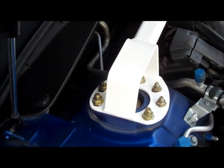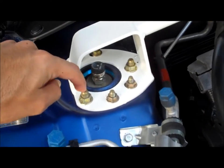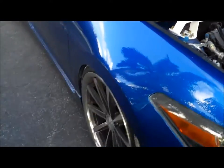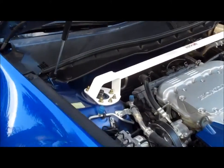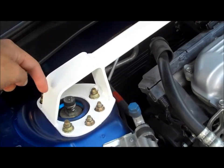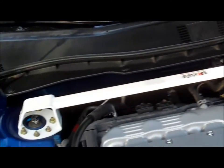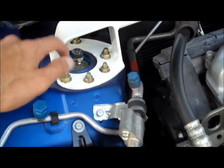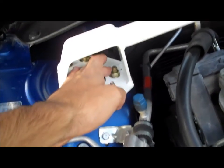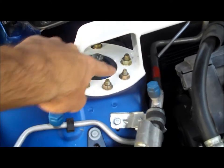On the UR, you actually have to remove all the bolts — these are 14s, the small ones are 12. While the car is not jacked up, that way the suspension is compressed, you're just going to unbolt all the bolts on both sides. Once you have that done, you slide the new tower on and bolt it all down. You do need a wrench for this one — I haven't tightened it down yet.